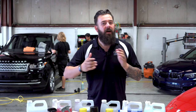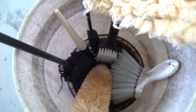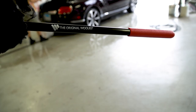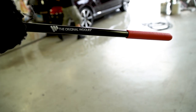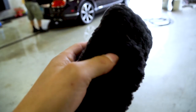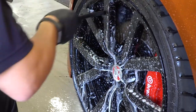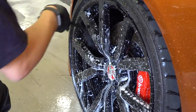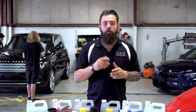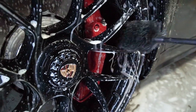If you're cleaning different types of wheels, you'll want a variety of brushes. The first wheel brush I want you to see is one of my favorites — it's called the Wheel Wooly. These come in all different shapes and sizes. They're made of plastic and feature fluffy synthetic wool heads, so they are super safe for any type of wheel. You can use the smaller ones for getting behind tight areas like behind the calipers, and the larger ones make quick work of the easy-to-reach areas. With the right tool like the Wheel Woolys, you can get the barrels of the rim just as clean as the face of the rim.